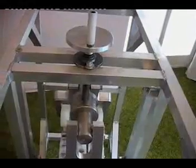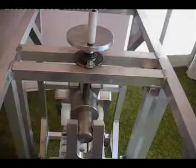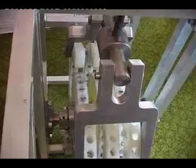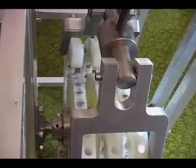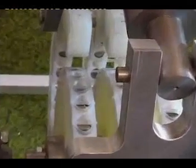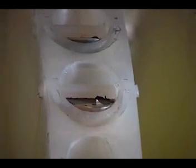This unit is with the manual speed control, which can be seen now. The later versions have electronic speed control. Going in now towards the rotor, you'll notice the magnets and the plastic stay pins. These are to keep the magnets in place. In front of the magnet you'll notice a half moon cutout. That is for the new shielding to go in, which we're currently waiting for.